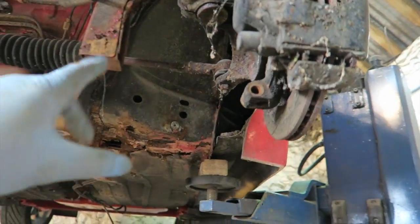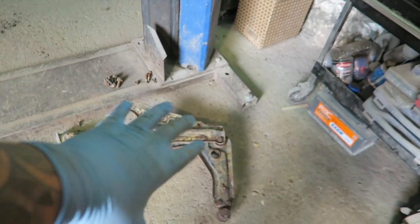Taking these front arms off, we're gonna be replacing them, making them really nice as well. Getting those off so I'm able to use as much space on here, so this is as open as it's gonna get, and now making the engine basically as small as it can. So I'm gonna take off the power steering, I'm gonna take off the air conditioner as well, because those are two things we're not gonna need in putting this engine in. And then we're gonna lower the car down, see how she fits.